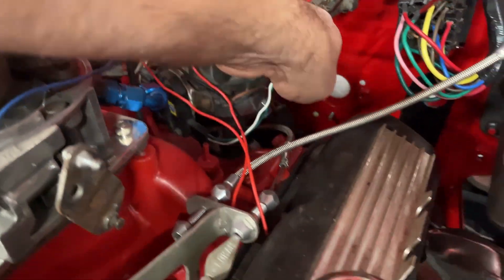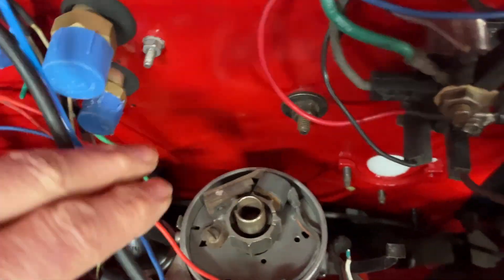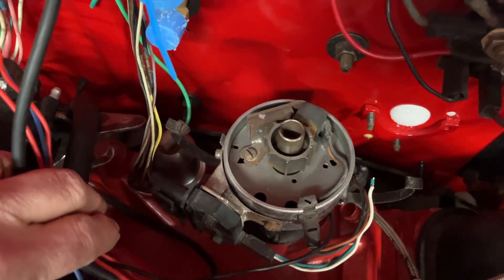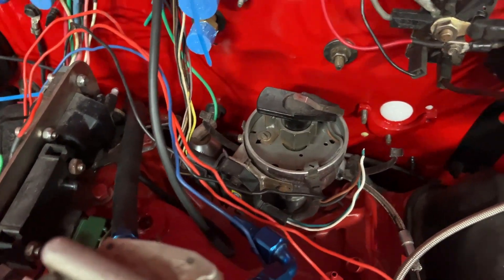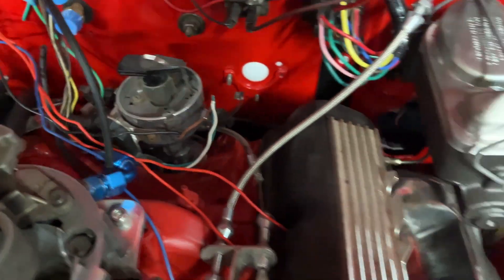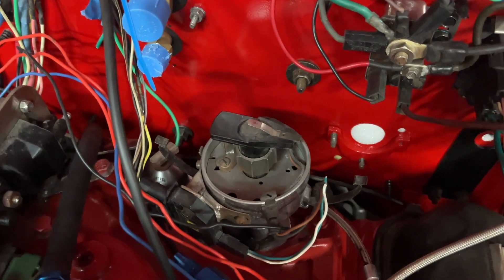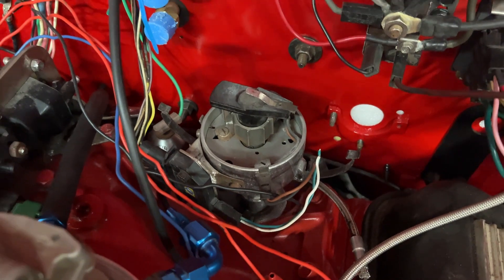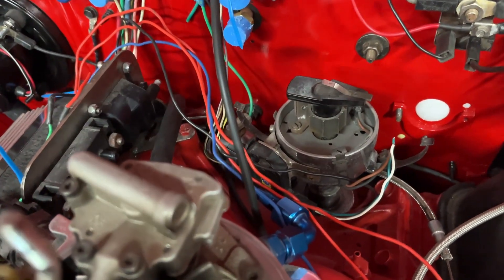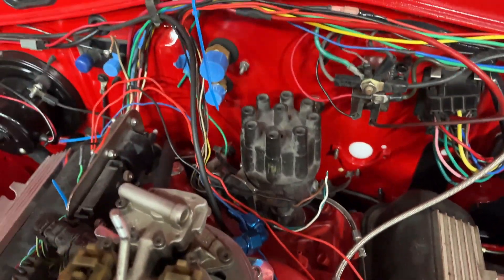Now you're thinking to yourself, how's that possible? Well, it kind of is possible. You'll notice something very unique about this distributor — there's no vacuum advance. If you go looking on that website and following along, there are instructions on how to modify a distributor that has the centrifugal weights in it, weld it together, clock it correctly. But the lean burn distributor does it by default. So if this is a project you want to do, us guys in the Mopar world finally have an advantage. Somebody's throwing out a lean burn distributor somewhere — pick it up, it's perfect. It's a bolt-in, not a big deal. You don't have to modify anything at that point.